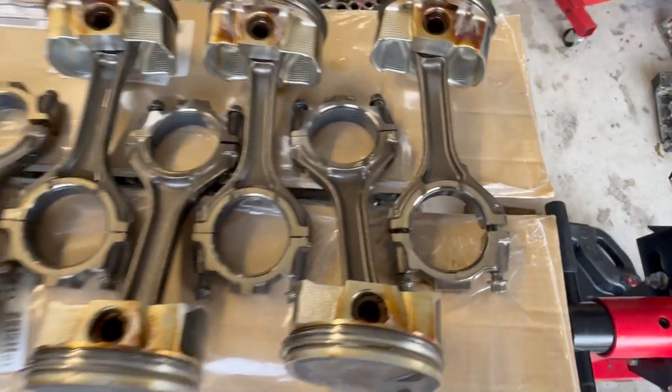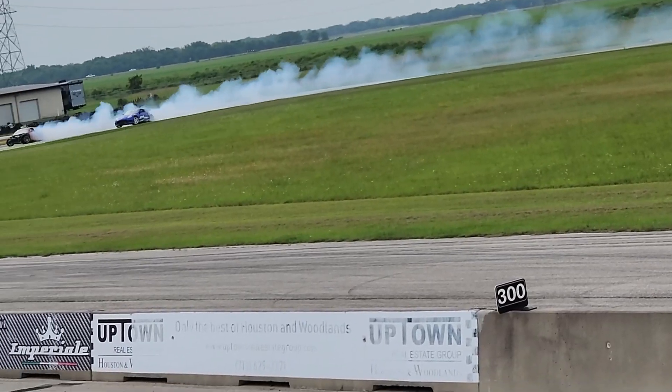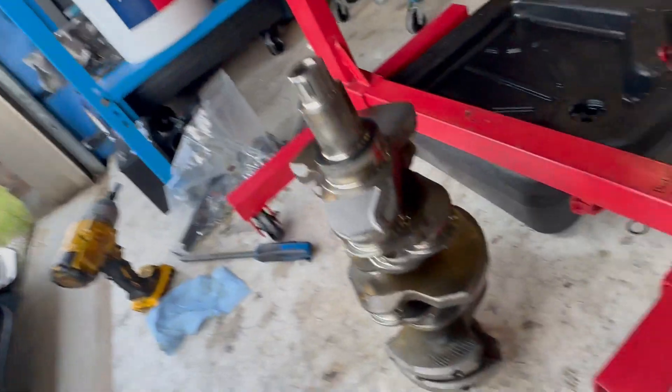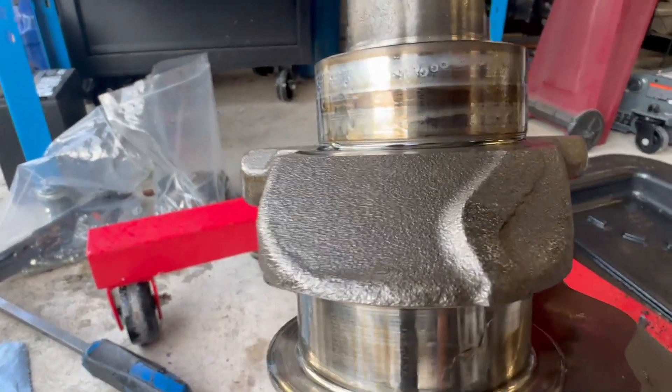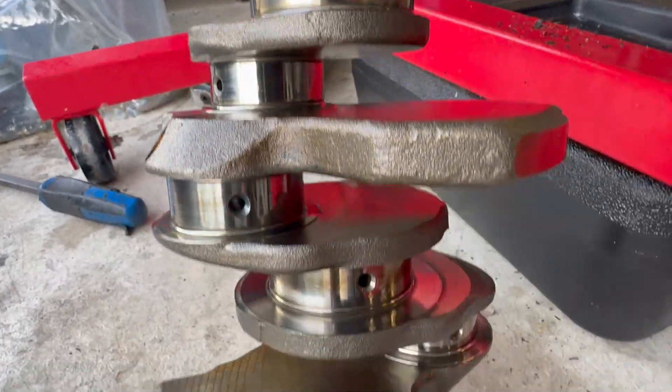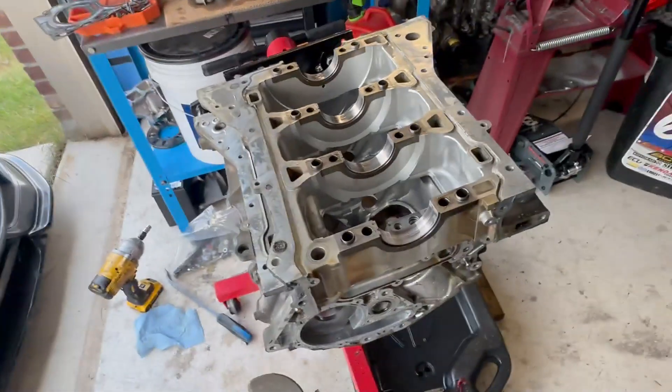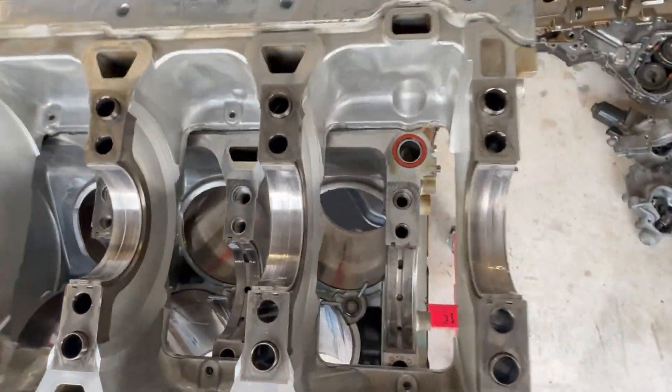All the rods look straight — this car has been seriously abused. Here's the crankshaft — still oily, but I'll get it checked to make sure it's still straight, and then I'll pay the machine shop ballpark 80 to 100 bucks to put a nice polish on it. This block I'll get closed decked. Then all I need is forged internals, bearings, ARP hardware, a little more machine work, and keeping it simple — that's how I like to build these engines.